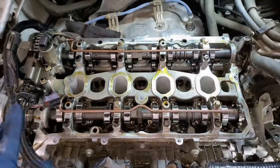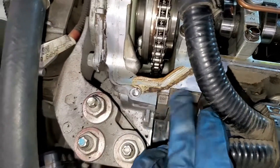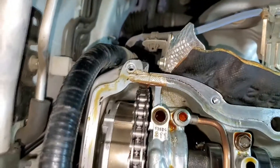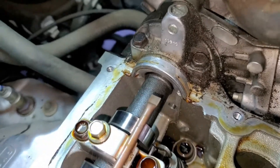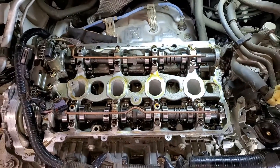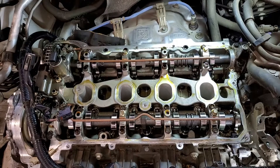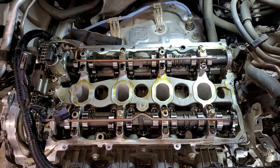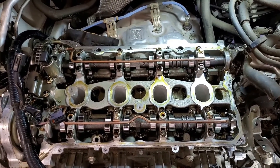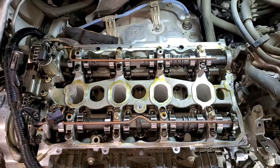I have got the valve cover gasket removed. You will notice that we will have to apply some grey RTV at this location, and at that location right there, and over this hump — so on both sides. Now we are going to go ahead and clean up the surface all the way around. Make sure you do not drop anything into the engine — everything should be going towards the outside. I have got quite a bit of dust because I have had this oil leak for some time, so we are going to clean up the surfaces, cleaning away from the engine so that nothing drops inwards.